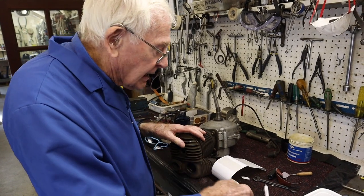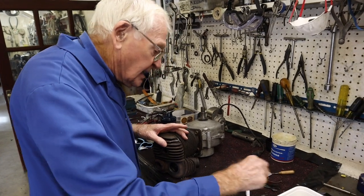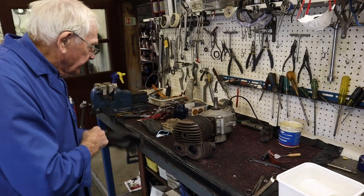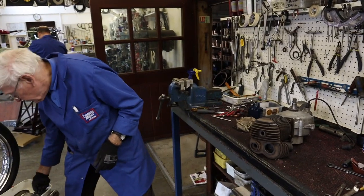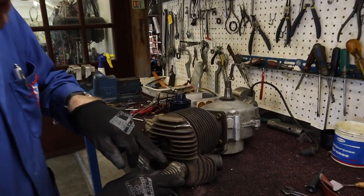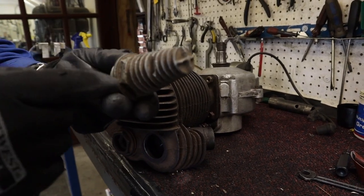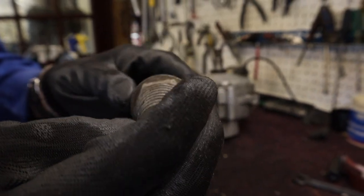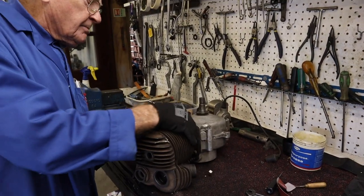Put that in the box so we don't lose it. Then we'll have the barrel off. You remember we spoke about the air cooler - the air-cooled nut on top of the exhaust valve that cools off the hot exhaust valve. That needs to be dressed up - it's been a bit butchered so I'll dress that up. Then we have the nuts off the barrel.